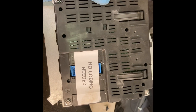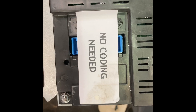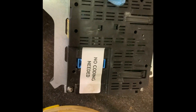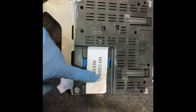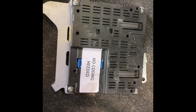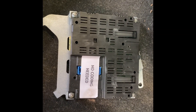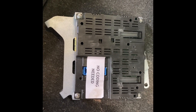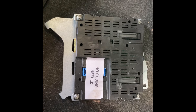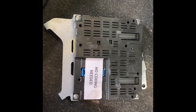As I'm about to put the module back in the car, it's important to talk about coding. For some versions of the Fiat 500 Blue and Me, the unit may need to be coded before being put in. The people we sent this off to have done the repairs and helpfully left a tag saying 'no coding needed,' so we can just plug this right into the loom. But if you're going to do this yourself, I wouldn't even know how to find out whether yours needs coding other than sending it off to a professional, so maybe a bit of research on your end.